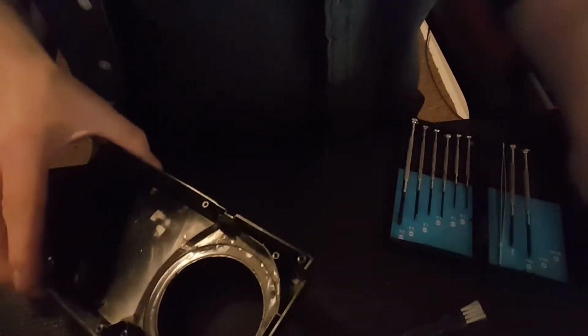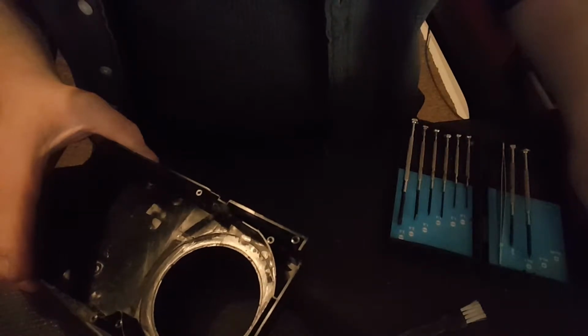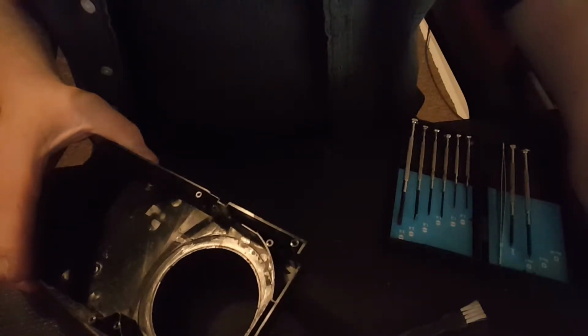Let's get rid of this. What else have we got? Let's see. Yeah, the clock speed on this is more than twice the speed of what's in Squiggly Bob's computer at the moment. This uses 150 watts, which still isn't a lot. And from the benchmarks on this website I found, which if you're interested is gpuboss.com, you can compare graphics cards. It's generally more than twice the speed. Some things it's coming up 4 times, other things it's coming up twice. The only things that Squiggly Bob's one beats this on are power usage, memory amount, and the clock speed of the RAM is slightly faster on Squiggly Bob's one, but everything else is a lot better on this one.